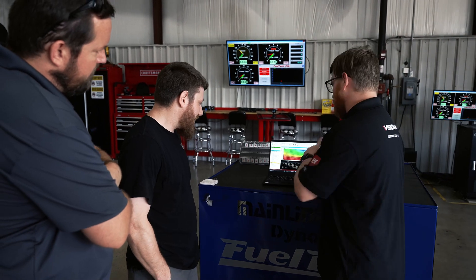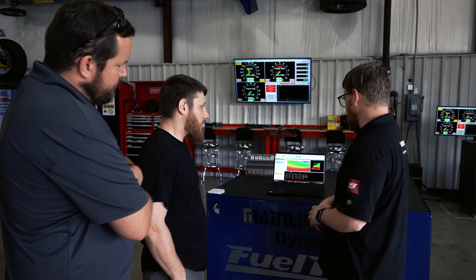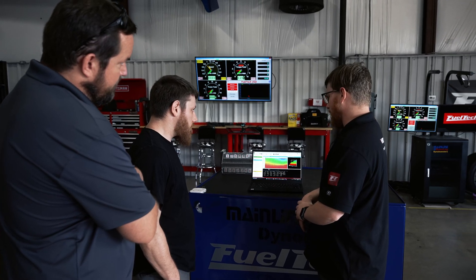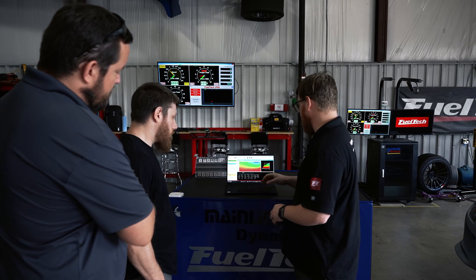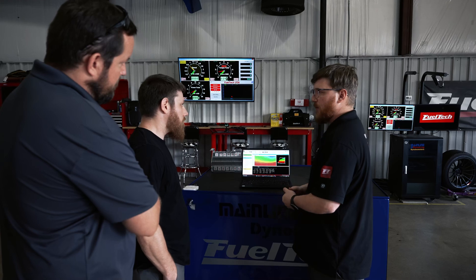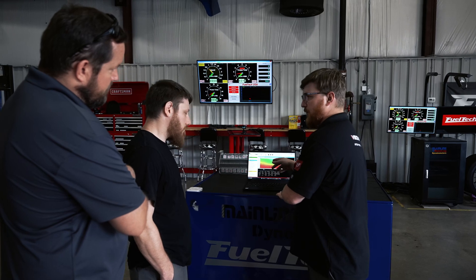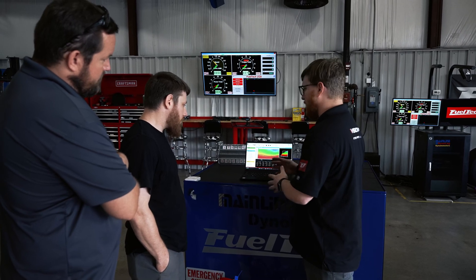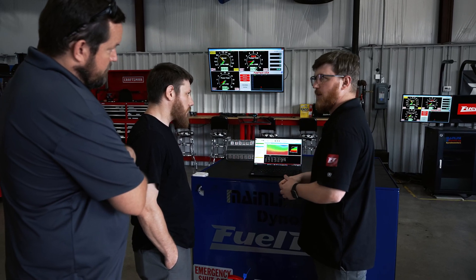So what we were doing just a little bit ago was basically some light driving, making sure that I had a general idea of what shape the fuel map had to be and how close it was for the areas where you're going to be driving around, cruising up a hill, that kind of stuff. It gave me a pretty decent idea of what shape this should be as a rough draft, and it's safe enough for us to maybe do a light pull on it now. This is the main fuel table and it's in milliseconds — that's the amount of time the injector is staying open for. The shape of this map should roughly represent the torque curve of your engine, so the peak of your fuel map is going to be roughly where the engine makes peak torque.